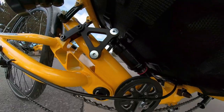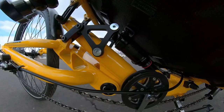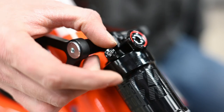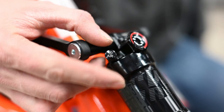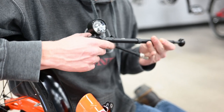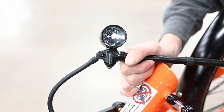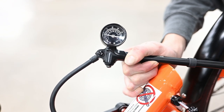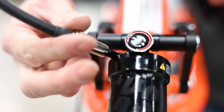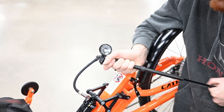The desired spec is 25 percent for best performance, but anywhere in the 20 to 40 range is acceptable depending on whether you want a softer or harder ride. The higher the number, the softer the ride. There is a valve on top of the shock next to the rebound dial — unscrew the cap and use a shock pump, as a regular bike pump won't reach high enough pressure. Adjust in 10 PSI increments: adding air gives a harder ride, removing air makes it softer.